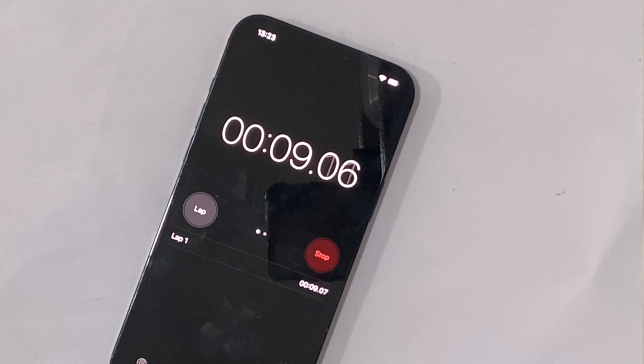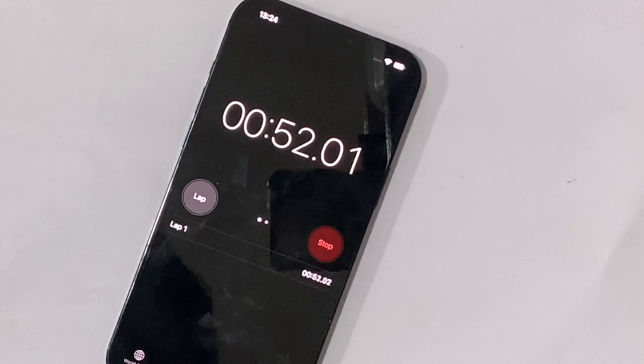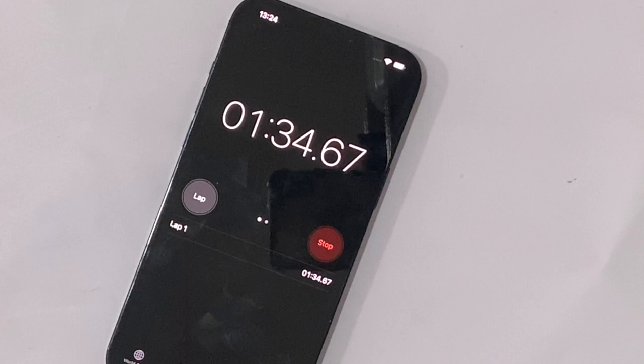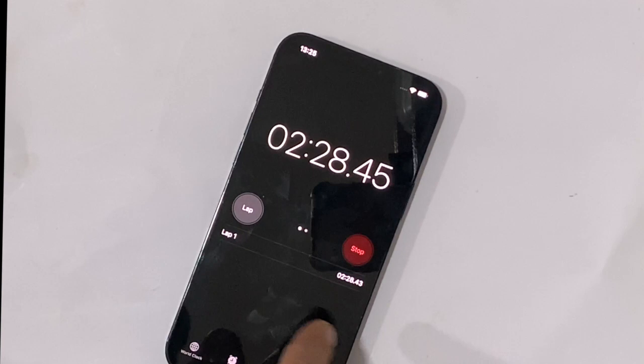iPhone X and up models have such issues, and even the 12 Pro Max can't escape from this fault. At a certain point, the timer freezes, and now the phone is restarting. If you face such issues, then don't restore your iPhone, otherwise you will get error 4013. Restoring in any case leads to losing your important data, and your iPhone may get stuck in recovery mode. If the iPhone randomly reboots, then the iOS system captures the log data.